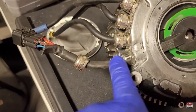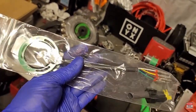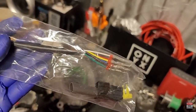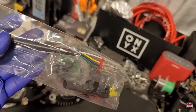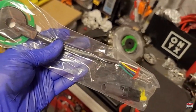Once we pull the terminals out the back side, we'll be able to pull the wire harness out this way. As you can see, this is our brand new hall sensor from Luna Cycle, and it comes without the connector on it for that exact reason - so you can install it by reversing the removal procedure.